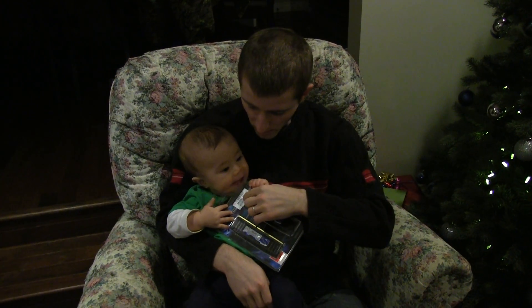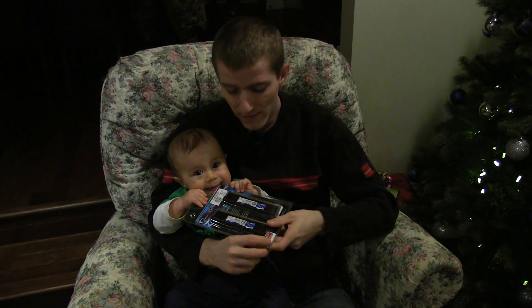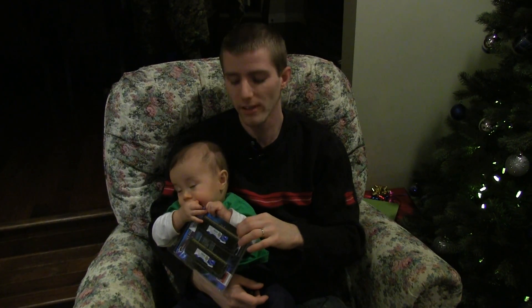These are a 1866 C9 kit, 32 gigs — so that's four 8-gig DIMMs — which means you can run them at DDR3-1866, 1.5 volt. You can run two of these kits, although you won't necessarily get those speeds.